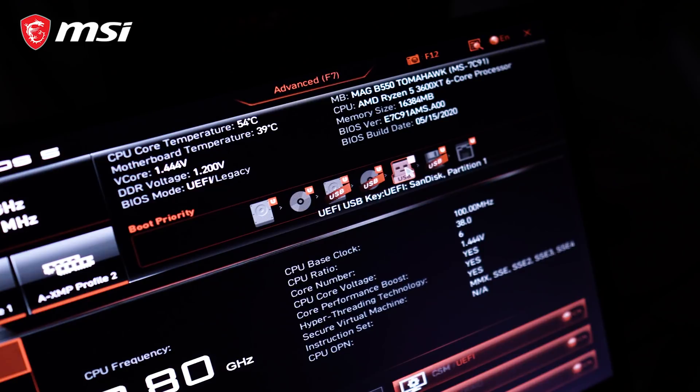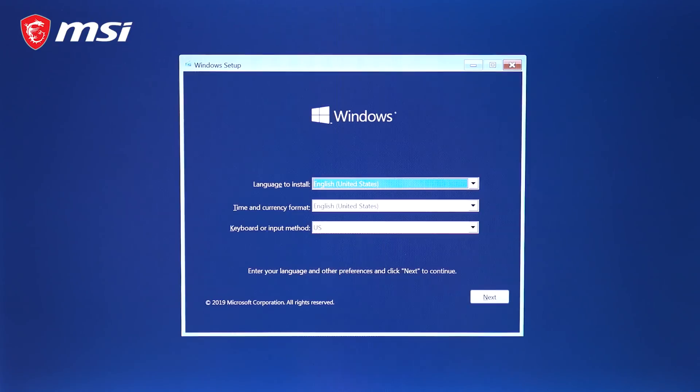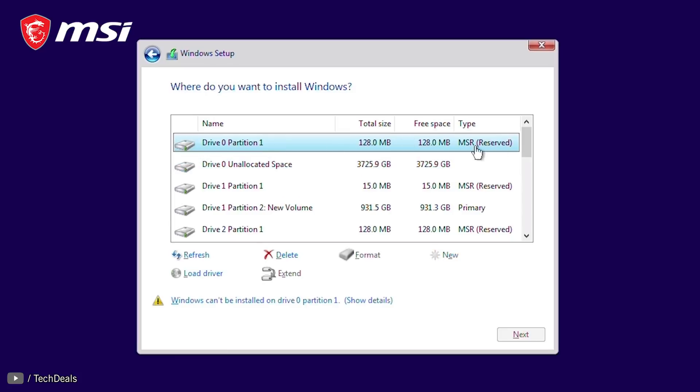If done correctly, you should boot into your new motherboard's UEFI. In the boot tab, select the flash drive as the primary boot device, save settings, and reset. After the cycle, you should see a Windows logo and then this screen here. Navigate like so until you arrive at this page, select custom install, and proceed to wipe your primary drive. This is the drive that will probably have all your important files on — again, make sure you've backed those up before doing this. This is going to be the drive that we'll call our boot drive; it's typically the fastest drive in our system.